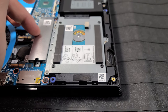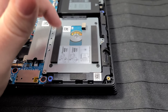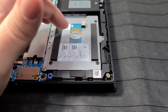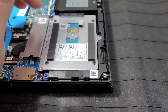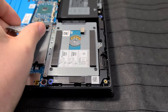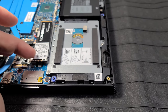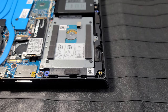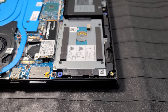Since this drive has the OS on it, what I want to do first is replace this with my new Samsung 2TB QVO drive, clone the OS from this to the Samsung drive. Once that's done and we're able to boot from it and ensure it's working, I'll take this out, replace it with the Kingston drive. That'll be just additional storage for games, and this Samsung will become the OS drive. That's what I'll be doing - stay tuned, we're going to pull this out and start the cloning process.